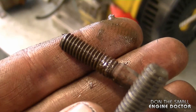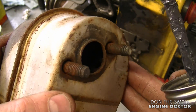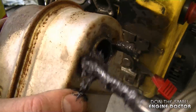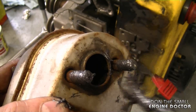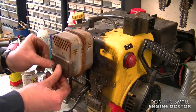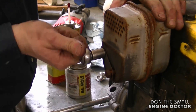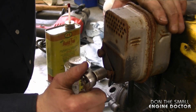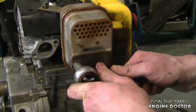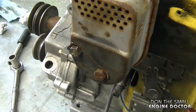Now you can go ahead and reinstall the muffler. After installing the coils you want to make sure that the threads on your muffler bolts are in good shape. Since I don't want that problem again, I'm going to put some anti-seize on the bolts — this will ensure that they never seize up in there again. The coils work excellent for threading; it's basically like screwing into regular threads. And even with the coils I was able to tighten up the bolts properly.